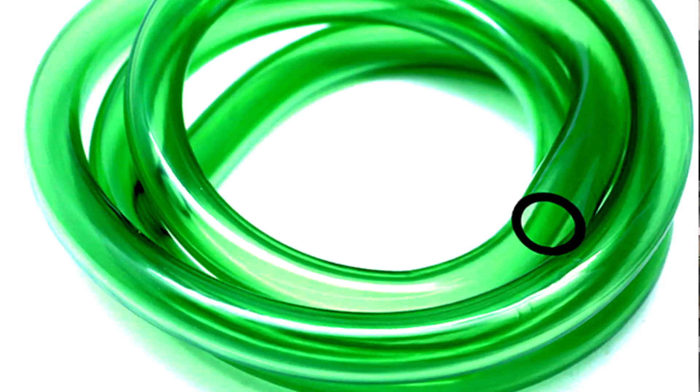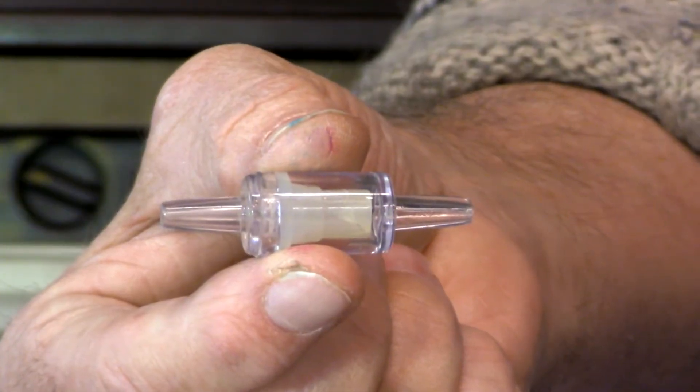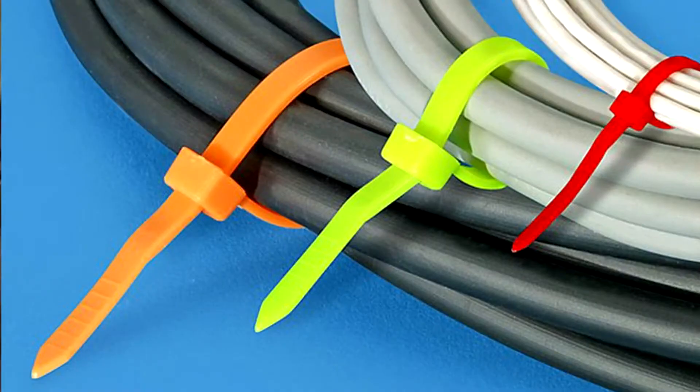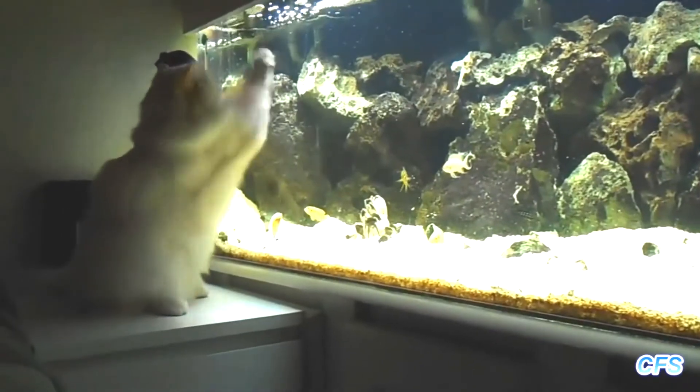To do this modification, you're going to need a couple of 2- to 3-inch pieces of small surgical-type plastic tubing, a small aquarium-type air pump check valve, a small 3/8-inch to 5/8-inch washer or O-ring of average thickness, a couple of small tie wraps, and a drill bit and drill. You can get both the surgical-style hose and the small check valve at any store that sells aquarium supplies. The valve and a scrap of hose shouldn't cost you more than a buck.